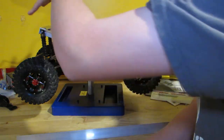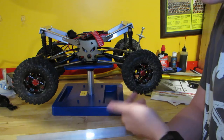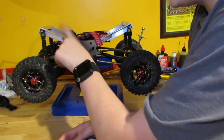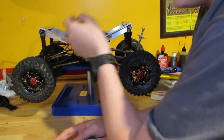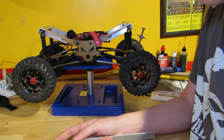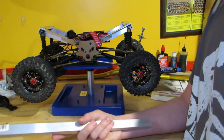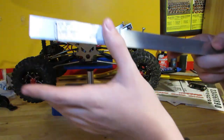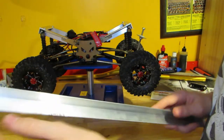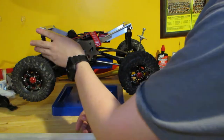So I'm going to go over the measurements and what material I used for it. You can probably guess what it is just by looking at it — but if you can't, I'll tell you. All this stuff right here is the exact same stuff that I built my trailer with. That stuff is extremely strong — I have had 50 pounds on that trailer and it didn't even bend. It's ridiculous. That is all 1/16th inch thick angled aluminum, and it is 1 inch wide. That is the magical size for this.